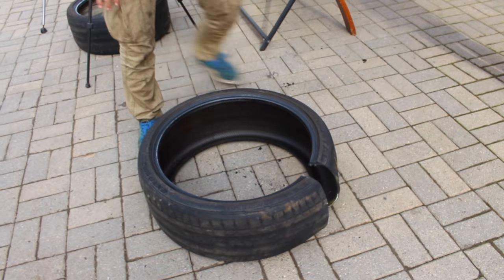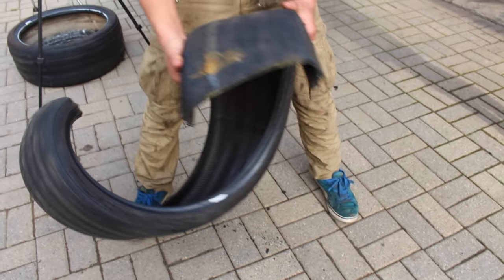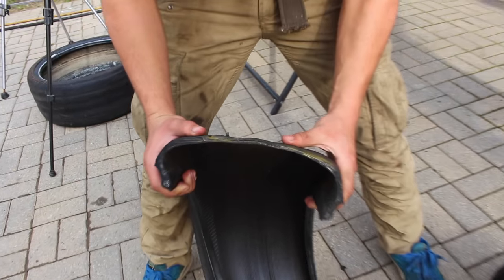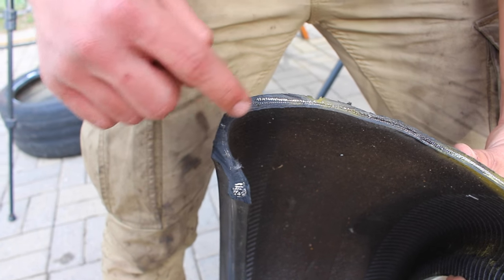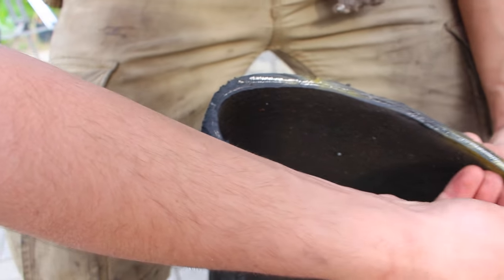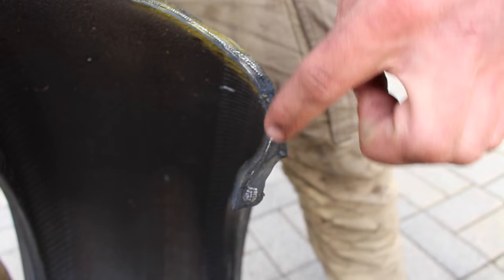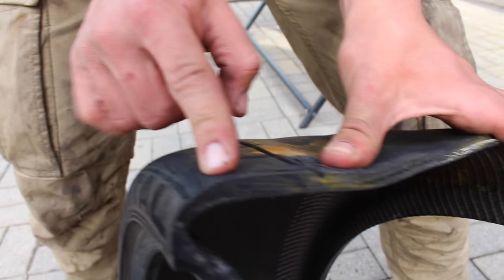And there we go, through the tire. Check that out — look at that, this is the middle profile of a tire. You can see we've got the steel bead on this side and the same thing on the other one. Everyone knows the tire is made up of steel and nylon, and you can see the nylon all on the inside. The nylon is a fabric — you can actually kind of see it there, looks kind of like a shirt. It goes from the bead all the way up the sidewall until we get to the tread.